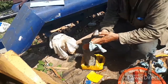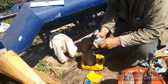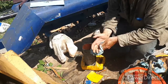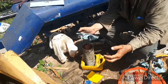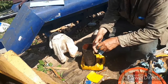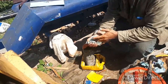And when you're doing wheel bearings and stuff like this, so much grease goes into that Varsol, and without water to help congeal that grease off to the side, it just stays mixed in with the Varsol, and stays dirty and no way of cleaning it. But with the water in there, it helps congeal the grease off into like a little sludge pit in one end, or even in the middle, one big sludge thing, and you can just scoop it out with a strainer to help clean it.